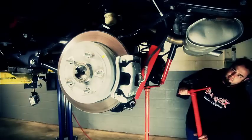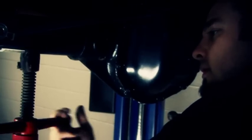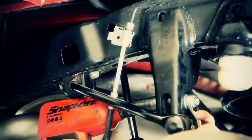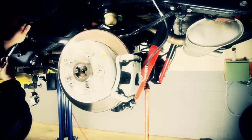Now that we've got the vehicle up in the air, we're going to throw some jack stands under it just to support that axle. That way when we take these track bar bolts out, it won't have any bind on it. You can pull those bolts out on the ground and have the same effect, or you can do it up in the air and just take some pressure off it with the jacks. After we've done that, we're going to go around and loosen every one of those control arm bolts, upper and lower. That'll let that axle have some good swing to it.